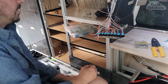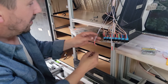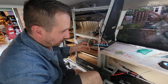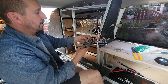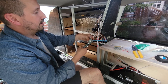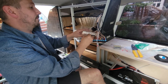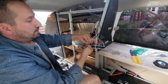I just realized I made an error - I was getting ready to crimp both of these to go into the switch connector, but only the positive does. It's been a long day. I'm actually going to cut this one off, re-strip it, and take this to ground, because everything grounds to the body in our van. I'm going to use extra long wire and double them up because I don't have large enough loops for this.